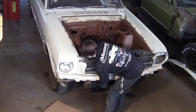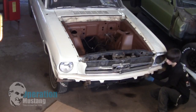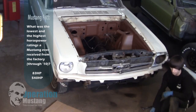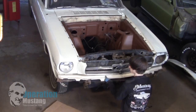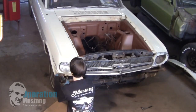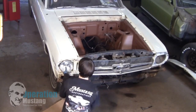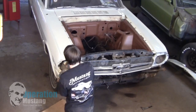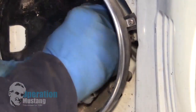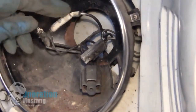Now we're removing the grill, the bumper filler panel — the white piece between the bumper and the grill, also called upper stone deflectors or bumper fillers. It's attached by maybe half a dozen bolts — not a whole lot holding it on. Slowly pull it out of the way. You'll also pull out the headlights, and behind the headlight there are a couple of plugs to unplug — that'll disconnect the park light in the front. Then gently push the wires through to the back of the headlamp assembly to get them out of the way.